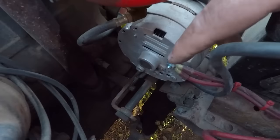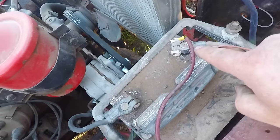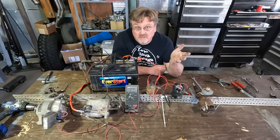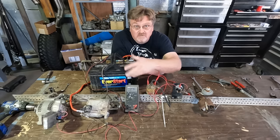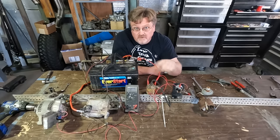This Jeep has a one-wire alternator, which is the simplest ever — it has one connection that goes right to your battery. If you're wiring up something pretty basic for just yard use, like a forklift, you can turn it on, start it, you have ignition, you have charging — you have everything you need right here. We're done. But if you want fancy things like lights, we've got to go a little further.